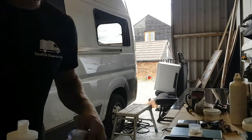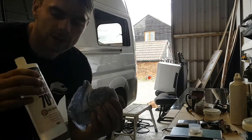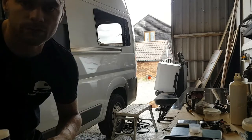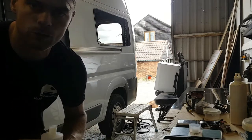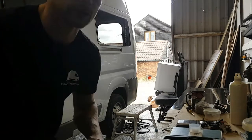I've put the rubber trim around the raw edge, painted that with Hammerite, and I'm about to wipe down the panel with isopropyl liquid. That basically gets rid of any impurities on the surface of the panel so that when I put the bonding adhesive onto the glass, it creates a really good strong seal around the panel and the glass.